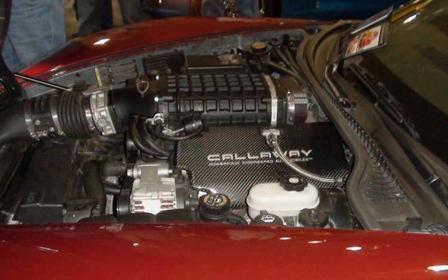The LS engine used coil-near plug-style ignition to replace the distributor setup of all previous small-block-based engines. The traditional 5-bolt pentagonal cylinder head pattern was replaced with a square 4-bolt design, much like the 64–90 Oldsmobile V8. The pistons are of the flat-topped variety in the LS-1, LS-2, LS-3, LS-6, LS-7, LQ-9, and L33, while all other variants including the LS-9 and LQ-4 truck engine received a dished version of the GM hypereutectic piston. The cylinder firing order was changed to 1-8-7-2-6-5-4-3, corresponding to the firing pattern of other modern V8 engines such as the Ford Modular V8.